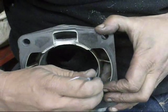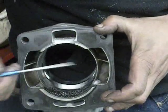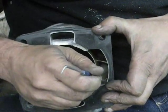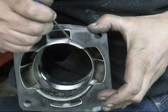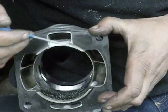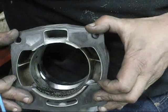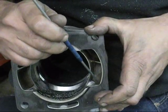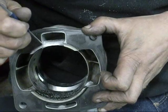I went ahead and cleaned up all my casting flaws. This cylinder was excellent — wasn't even really that bad — but we took care of it anyway. Little things mean a lot. When I take my gasket and mount it to this cylinder, you can see this ridge right here, and here also, and what I'm most concerned about is right here. This is all power that's just waiting to happen. So I'm going to lay the cylinder down, put some Dykem on it, and then go ahead and trim this right to the edge of the gasket. I'm also going to do the same thing to the cylinder — it's called match porting.